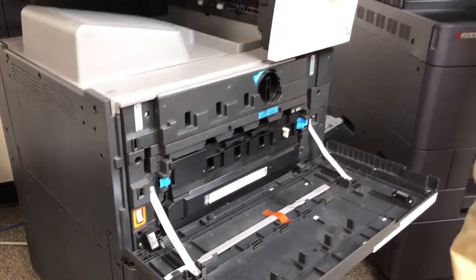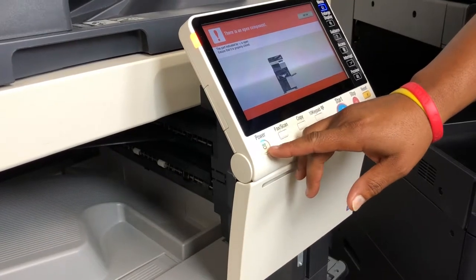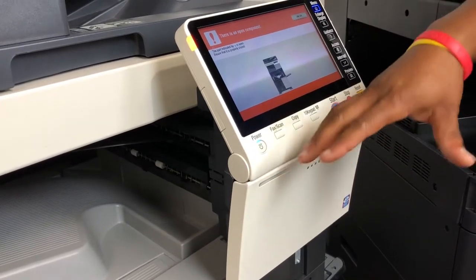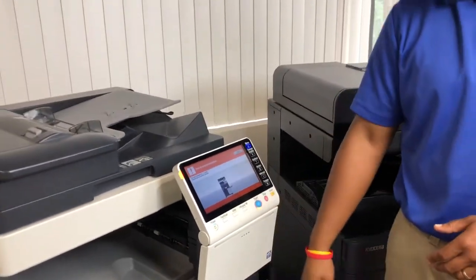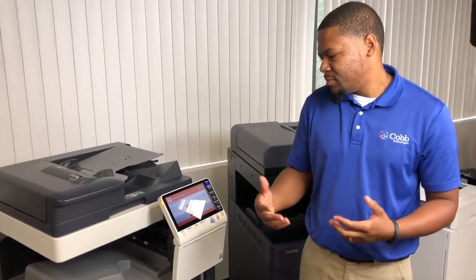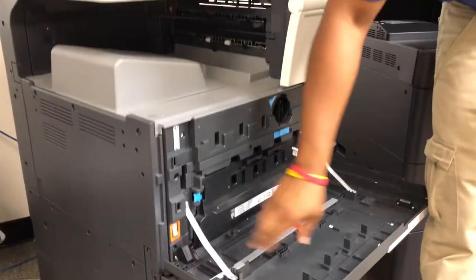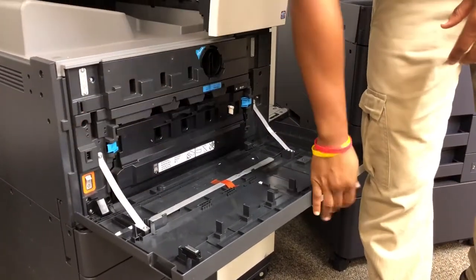If you look at the op panel, it has a power switch here — this is your soft power switch. This one has a little green leaf. If your machine is asleep or not completely awake, this is the button you push to wake it up if you need to scan. This machine does have a proximity sensor, so when you walk up to it, it'll probably turn itself on. But if you have problems, if you need to reboot it, or if you have changed any settings — network settings, scan locations — this button is not going to do it for you. You're going to have to open the front door; it'll be on the far left or far right side. That button will turn the machine completely off.